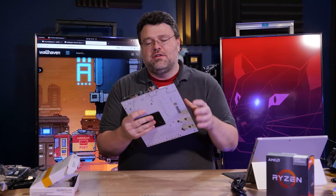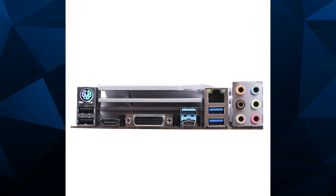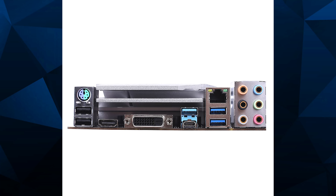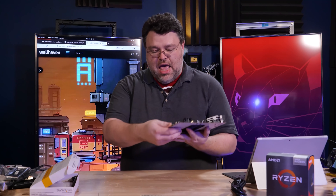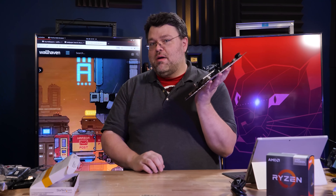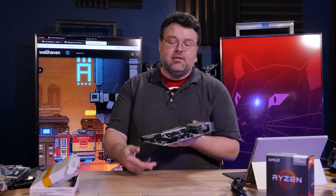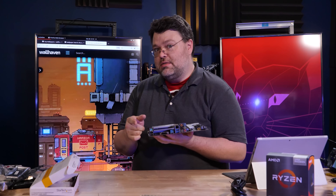The Colorful is probably an interesting choice, but it's got a 7.1 built-in sound card solution. It's got a reasonably okay built-in NIC, and we've got a pretty good selection of USB ports on the back and available on the edge connectors — USB 2 and 3. It's perfect for a front panel connection. If I had one complaint, it's the lack of a DisplayPort out on this particular B550 motherboard, but it was inexpensive.